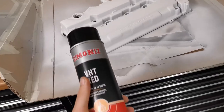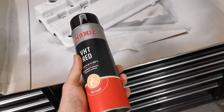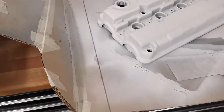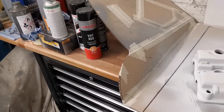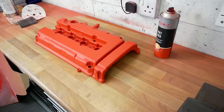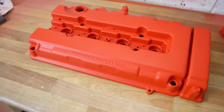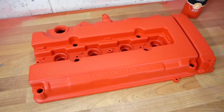The red is the next step. I'm going to be using this VHT very high temperature Simoniz stuff — never used it before, might come out crap, there's only one way to find out. Well, that's not gone particularly well. Left it almost a full day of air drying and the finish still looked really really good. To fully cure it though you've got to bake it in the oven — which made the house smell absolutely lovely — and unfortunately it all kind of went to shit.